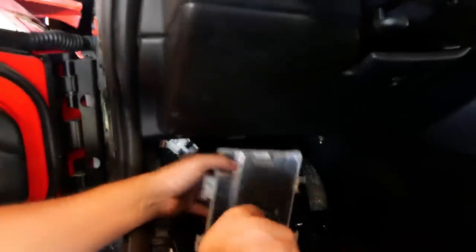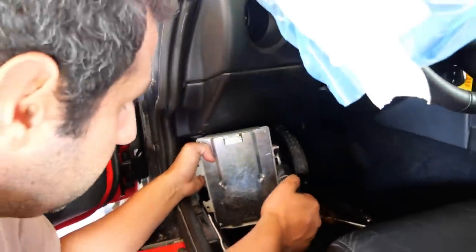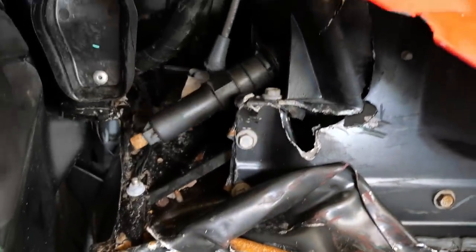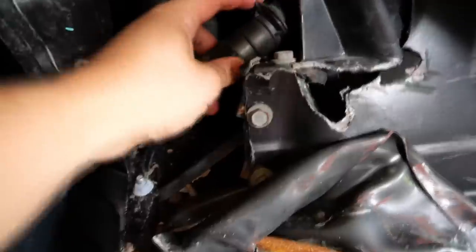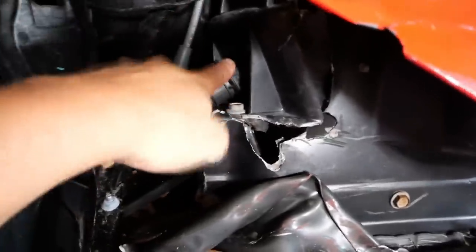Credit to Sage for getting the body control module out of the corner — it was really stuffed in there and the wiring is still plugged in. There is exposed circuit board; this is not a sealed module like the one in the engine bay. The bracket was broken off too, and looking from outside the car, that's exactly where the BCM is mounted. It's also why the clutch pedal is toast — it's not mounted to anything, just moving freely in and out.